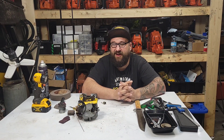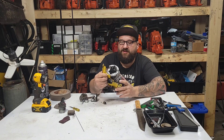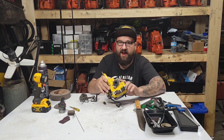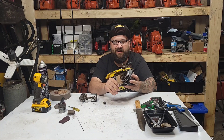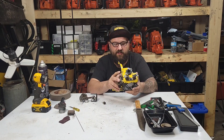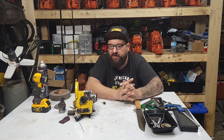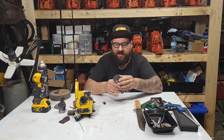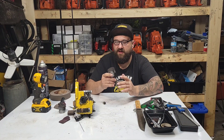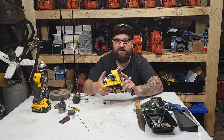This channel is always about learning, and a lot of that is me learning. Just because I'm in front of the camera doesn't mean I know everything. Quite a few suggestions about replating this — we might actually do that. I'm going to reach out to several places in North America that do it. It would be interesting to have this bored and plated, then put it back together with a new piston. I'd love to port it first, but it's really hard to get pistons for these Macs. If I can find one, I'd like to modify the timing just a hair — I think we can get a little more speed out of it.